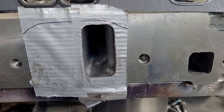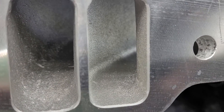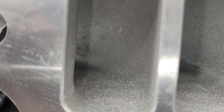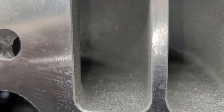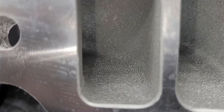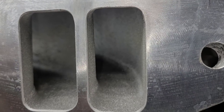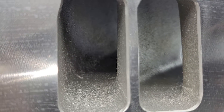The casting itself looks quite good - in fact it's better than the Chevy Victor, because on the Chevy Victor the inside cylinders turn right at the opening, they're a very steep turn and they're tough to get equalized with the rest of the runners. This will work out nice, but it's going to require a good amount of work - not going to be five minutes worth of work.